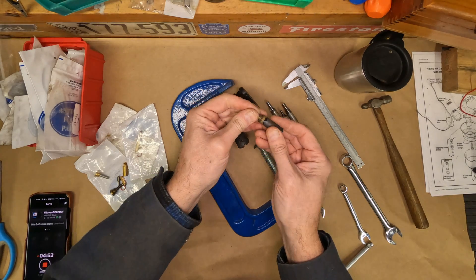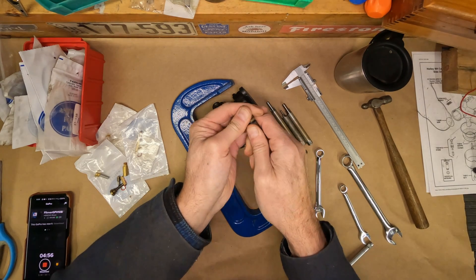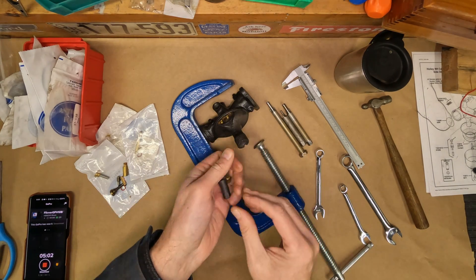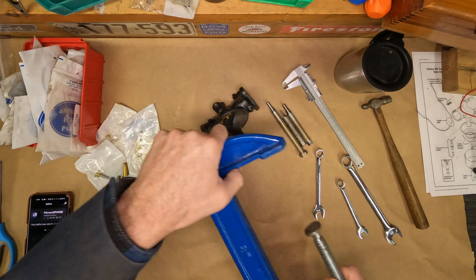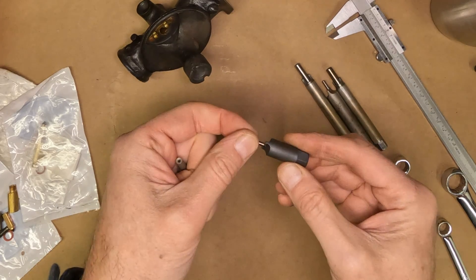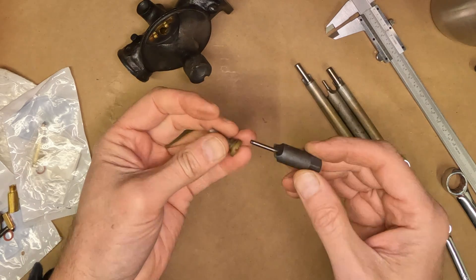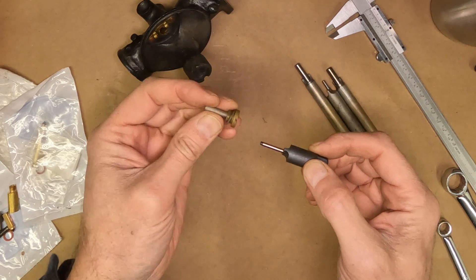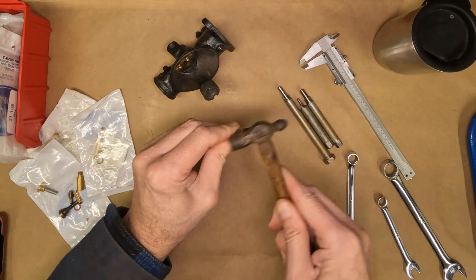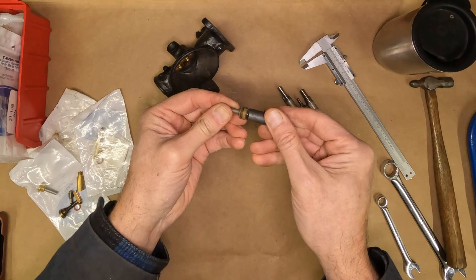So these extractors fit really tight, which is good. They've got a drill bit that's sized to fit the hole, and some blades that are sized to fit the slot, and then they're a tight fit. We were tapping them in there so that we get a really snug fit. Now these can be used for extraction and installation.